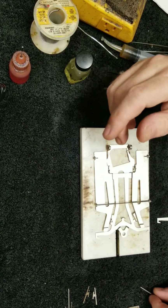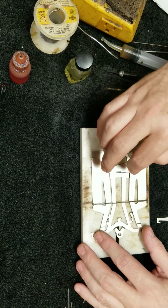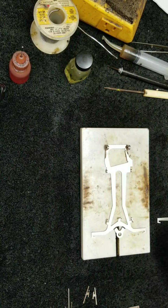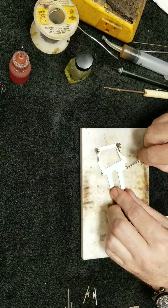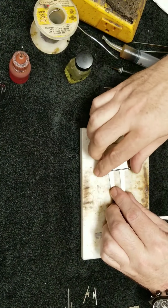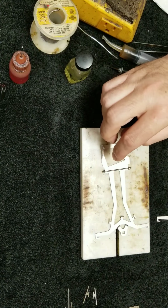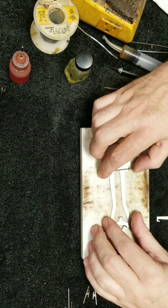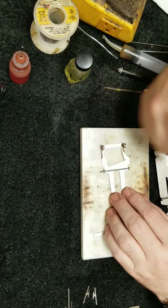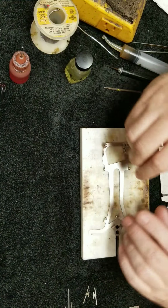So I had started off, when I had the car together, just putting a piece of tape. Now, this will probably be a better way to show you, but imagine the pan's on there, and the tube goes through there like so. I would put a piece of tape on here to keep the tube from moving around and beating up against the stop in the pan and knocking the head out, which would then, the pin would come out on one side and the tube might come out.